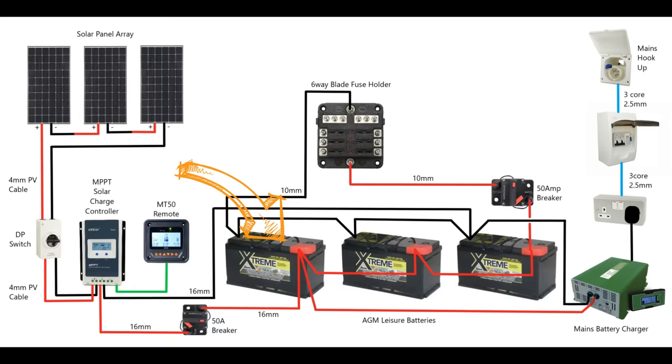The inverter can be really big — I've got a 2000 watt inverter, so the cable connecting to the batteries needs to be really big. In my case that needs to be 35mm and I've got a 200 amp breaker on the positive side to the inverter. Because I've got 35mm cable connecting to the inverter, the interconnecting cables between the batteries also need to be 35mm, since potentially I'm pulling power through that whole battery string. Those interconnecting cables that parallel the batteries together need to be rated at your highest rated appliance — so they all need to be 35mm cables.